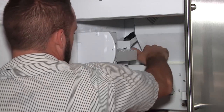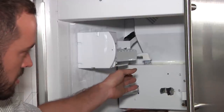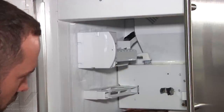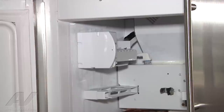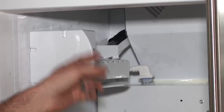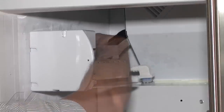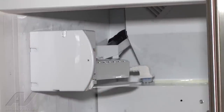Go ahead and hook the harness in, and as it goes through a harvest you'll see the lever arm slide out. As you can see the lever arm is coming out and the rake is making a rotation. This ice maker fills when the rake is right around the nine o'clock position. The ice maker has filled.